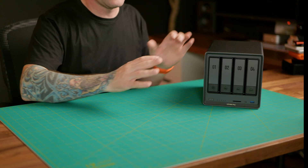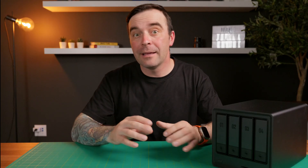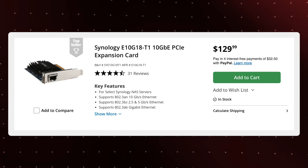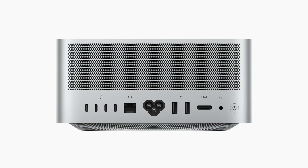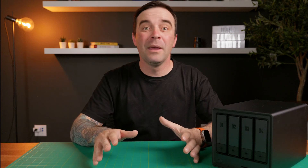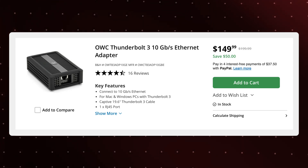Another reason I chose this NAS over other brands is it comes with a built-in 10 gigabit ethernet port. While other brands are compatible with 10 gigabit ethernet, you usually have to buy an expansion card — they're not super expensive, but it's still an extra cost. The Ugreen NAS Sync 4800 Plus comes with two ports built in: a 2.5 gig and a 10 gig. To take advantage of this fast port, both your computer and your NAS need 10 gig ports. If you have a Mac Studio, or you're upgrading your Mac with a 10 gig port, you're good to go. If you have a laptop or just a 1 gig ethernet port, you can get a USB-C to 10 gigabit ethernet adapter — they're not cheap, but well worth the price.